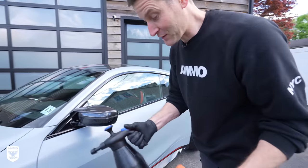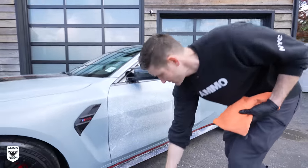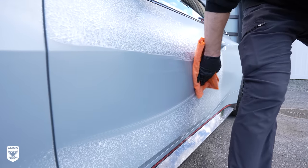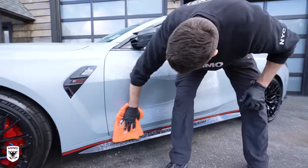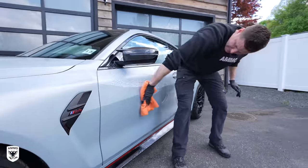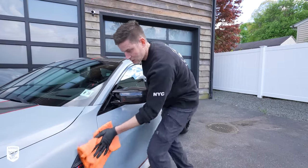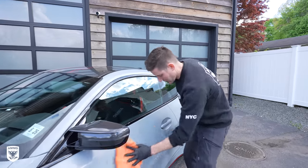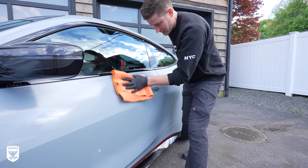If it's dirty like this where there's a little bit of spit-up, I'll take Frothy and lay some down like this. This is just a lubricant — come in and gently scoop it up. Look at that, gone. Flip it over, gently scoop it up, and it's not going to leave any waxes or anything behind. When you're done, it's perfectly clean. It takes a few minutes, but the idea is you're using a ton of lubrication. You have no margin for error when you have matte finish paints — you cannot scratch the paint. The more lubrication, the better.